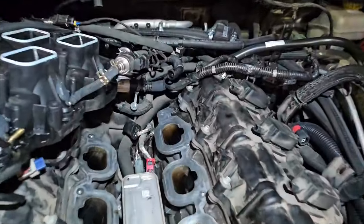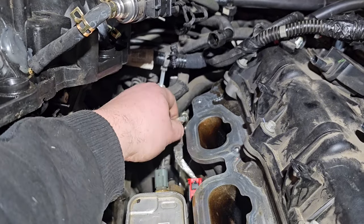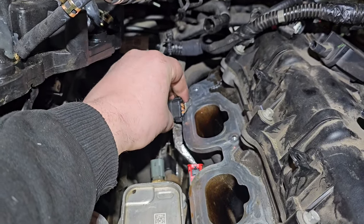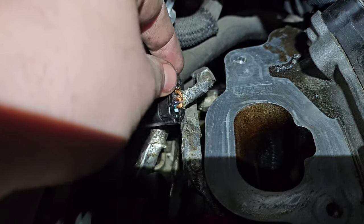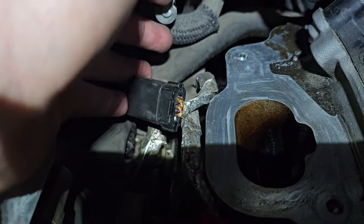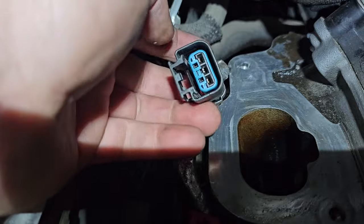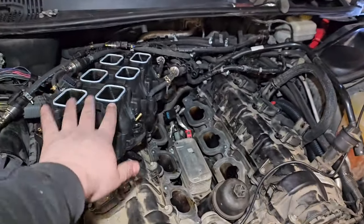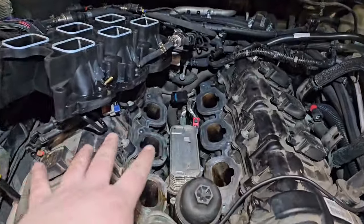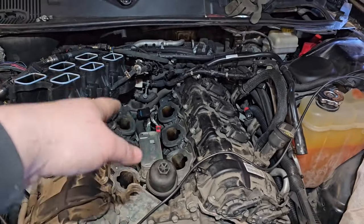It gives you the fault code and will not allow the five volts to be pushed out as long as there is a short circuit. And as you can see, it's pretty much shorted — you can see this aluminum foil, which gives more short to this point, and it's a little bit jammed in here. This is the oil pressure sensor. To get there you need to remove the intake top, injectors — just a couple of bolts, not a big deal — get those things out.